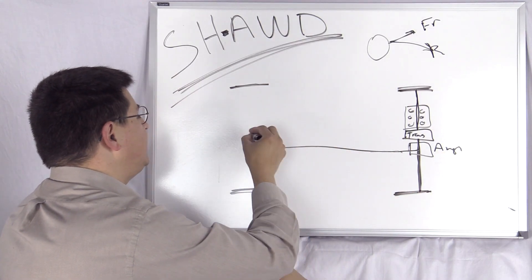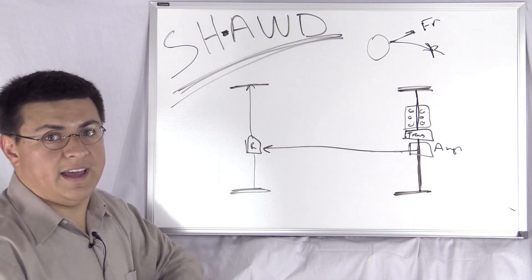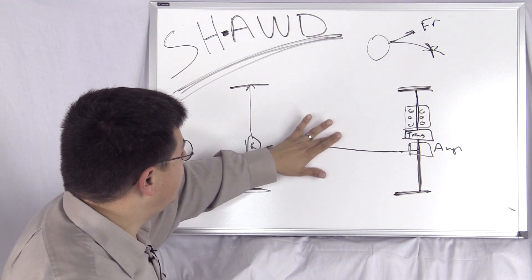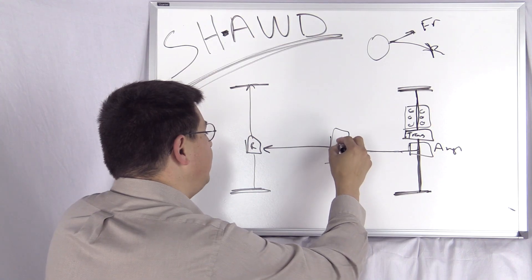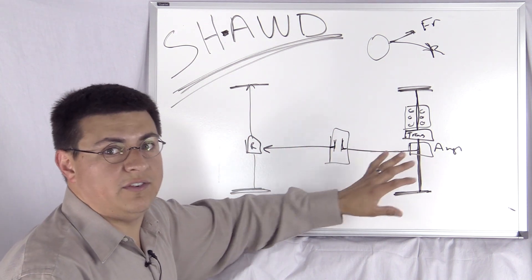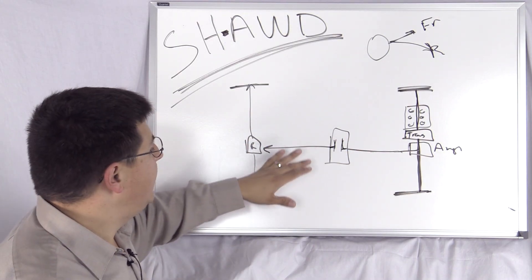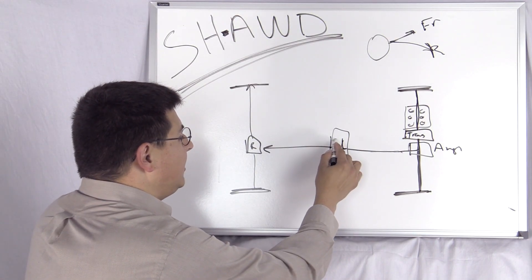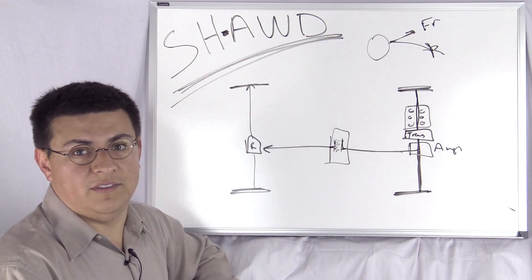The power leaves this angle gear and heads to a rear differential unit, which also contains bevel gears since it's sending power across the rear axle. A vehicle like this can't use a traditional transfer case, so to keep the front and rear wheels from binding in corners, a clutch pack is inserted in the middle — acting basically as a center differential. This allows the rear and front differentials to spin at different rates and allows power transfer front to rear. However, even with the clutch pack fully connected, the maximum rear power split in a traditional transverse AWD layout is 50%.